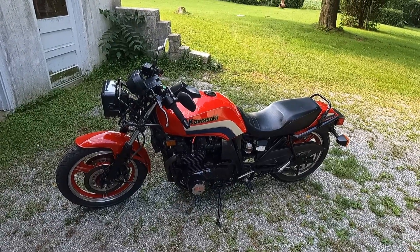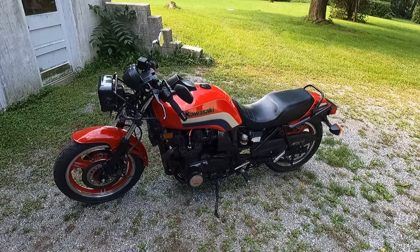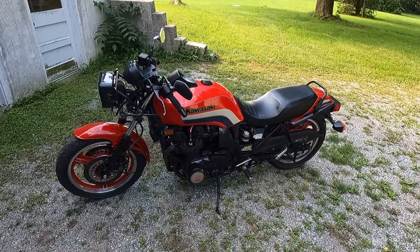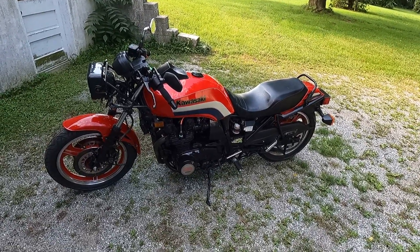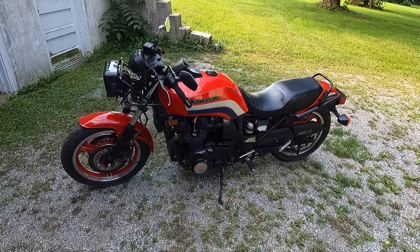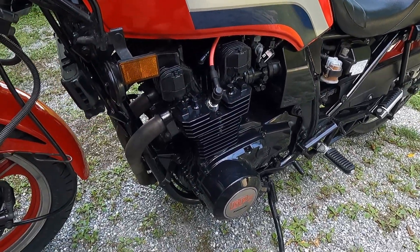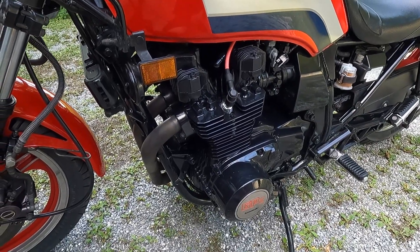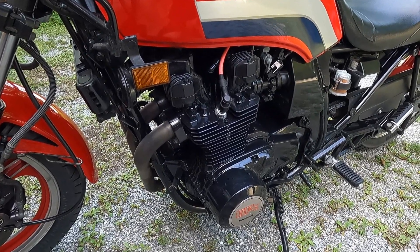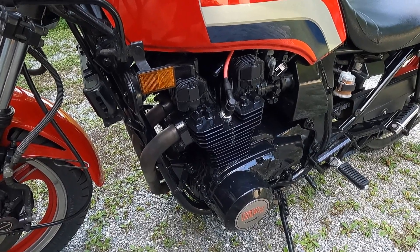It's already firing on all four cylinders — all four exhaust pipes are hot now. A lot of the smoke I was seeing was the residue that had built up in the exhaust over time. If it wasn't beyond quarter throttle, the two left cylinders had no air getting to them, so all that fuel was just dumping into the exhaust system, carboning it up. I think that's what most of the smoke was — at least that's what I'm hoping.